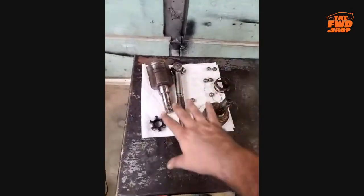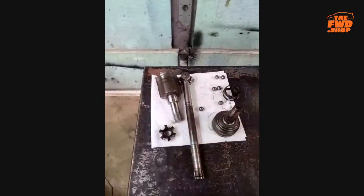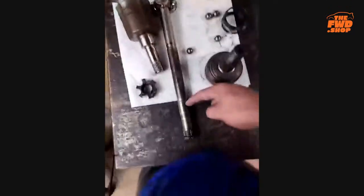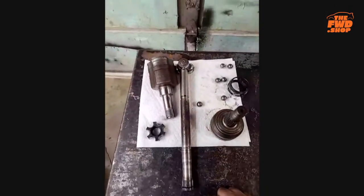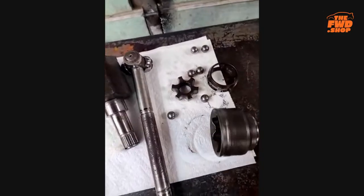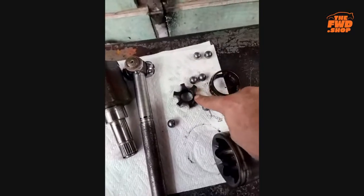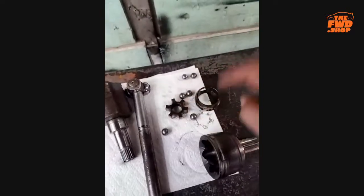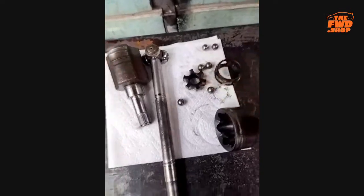A lot of axle failures tend to happen in kind of 3 places that I've figured out, okay, that I've seen, right? The first one is that they'll just break the shaft. If something happens where you shock load the system, you'll just break the shaft in half, okay? The next one that happens is in this region, okay? You can include the cup, so you might break the outer cup, you might break the retainer, you might break, I don't know what they call this part, but you might break one of these 3. That's what happened to me at Bristol. It got really hot, it locked up, and I ended up breaking this part when I tried to turn too far, okay? So that's what happened to me.